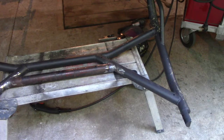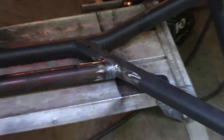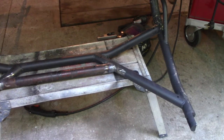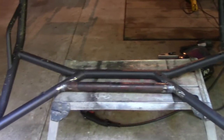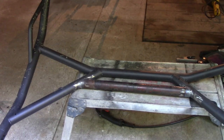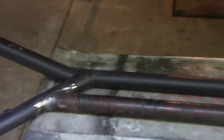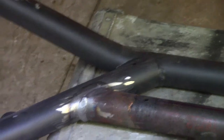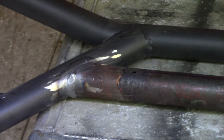We've got it welded on — it's kind of staying there permanently, welded shut. I've got to probably drill a little bit of weep holes. Actually the top might have enough — when I flip it over I'll see. Because if water gets stuck in there, I don't want it to leak into the speaker. You can see those weep holes at the top of the original pipe. I'll just drill a couple of weep holes.